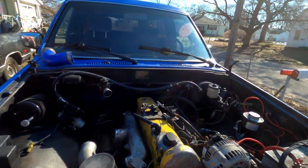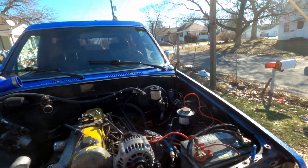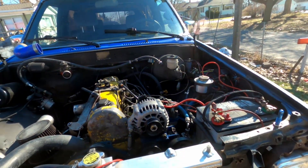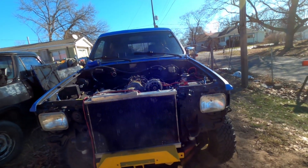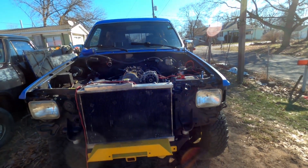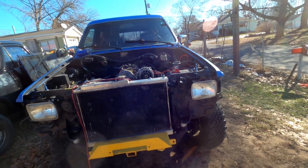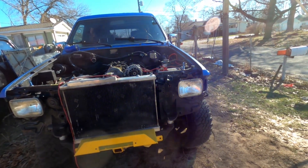The discharge is just an elbow — it's not intercooled and doesn't seem to need to be intercooled. I never see really high EGTs, but we'll see when this head comes off. The second glaring thing I'd like to change is this giant radiator. It's for a Nissan Skyline and somebody on the internet said it dropped right in — when it showed up it absolutely did not, and I had to hack and cut to get it in there.